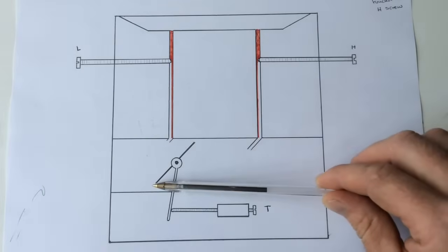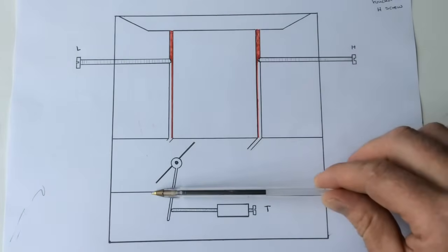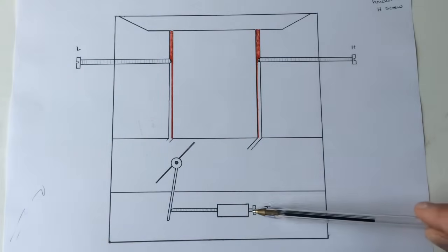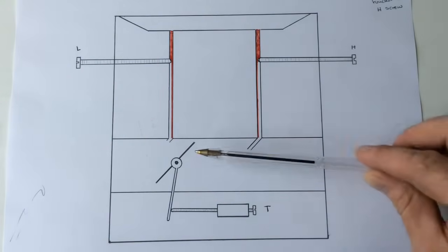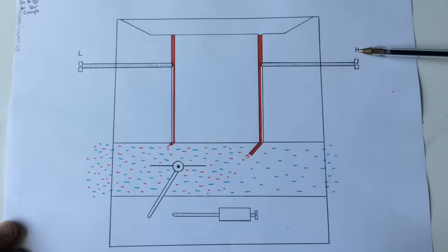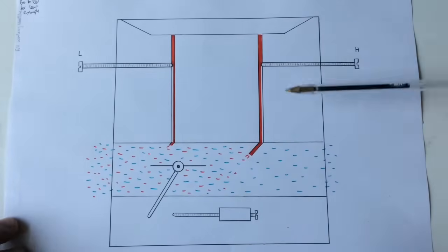...so the butterfly is slightly off the sides of the venturi - that's the way I normally do it, just slightly off. The slight opening of the tick over screw and one turn of each - I always concentrate on the H, the high screw, first.